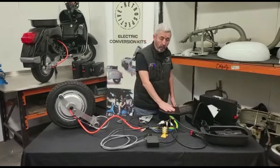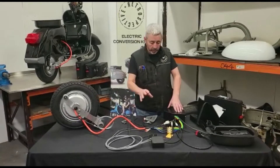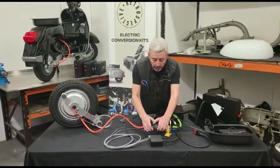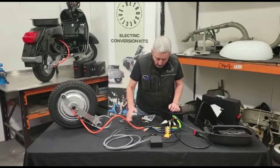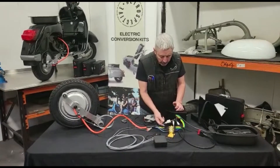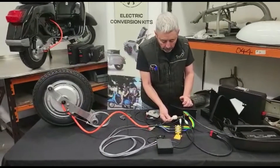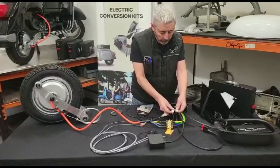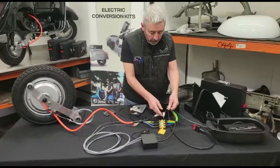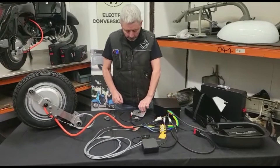The swinging arm hub motor is connected to the control box, and the control box is connected to a throttle sensor which is inside this box — that is still cable operated as well. You have your hall sensors here which bolt to the control box, and you have a plug here which connects the hub motor to the controller. Here are the two plugs: this is the throttle sensor and this is the safety switch, which is inside the box and activated by a cable as well.